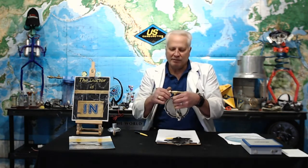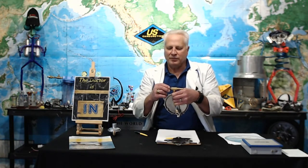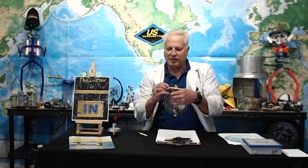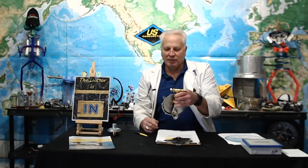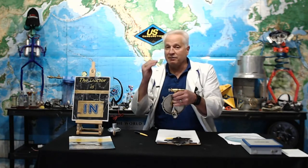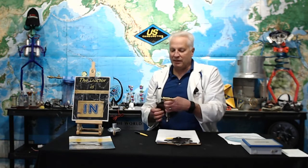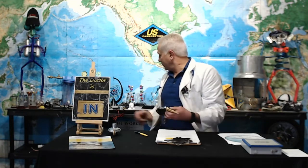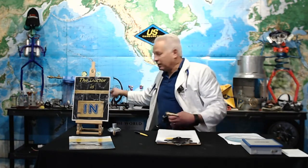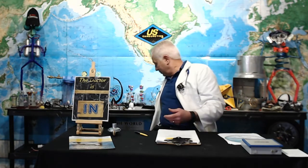After it's up and running without a load, I always bring it out on the rich side till it starts to slow, and then back right in until you get the RPMs back, and then pretty much just finger tighten the lock nut, and that'll usually handle it on the rich side of idle, no load. But definitely final adjust it under load, and hopefully you have the tachometer so you can watch the RPMs and verify that as you adjust it, it's making the difference. Because you can't hear one or two RPM change unless you're really good.